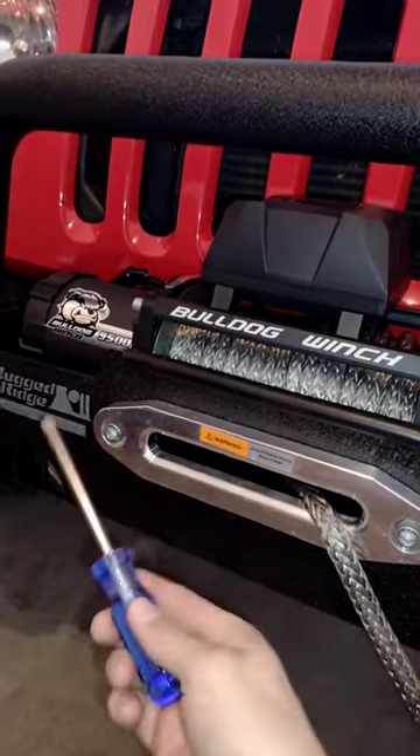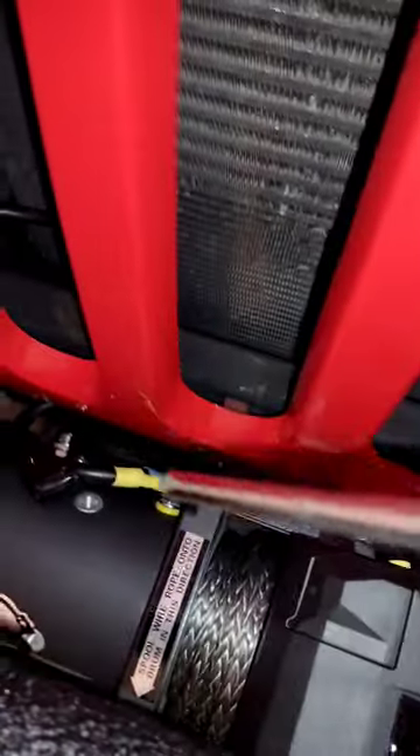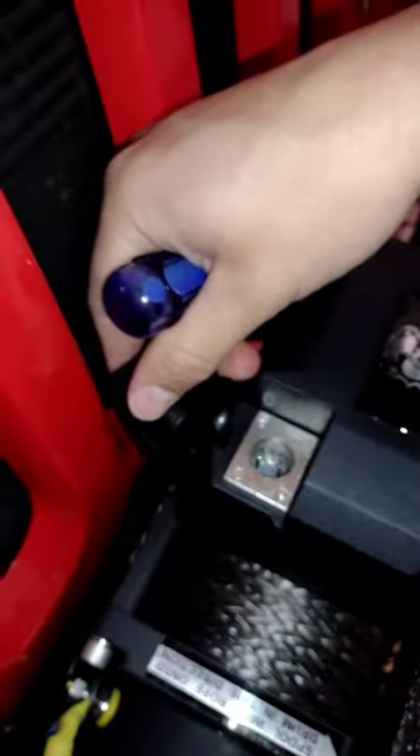Taking the winch out of the box, you're going to have all one piece here, and then you're going to have the electronic control box with all the wiring in the back. Now the first thing you're going to do is decide where you want to mount your control box. In the instructions it's going to give you an option to mount it to the side. I have chosen to mount it to the top just because I think it looks nicer, and also I knew it was going to be easy to access this little rubber port here where you'll plug in your remote.